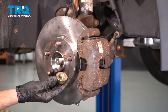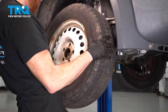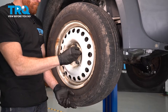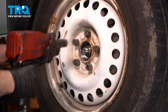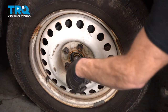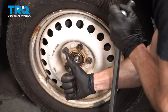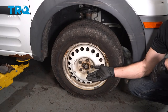After you've done that, you can continue on by putting on your axle nut. When you do this, you want to make sure that you tighten it up by hand as much as possible. Continue on by putting the wheel on. After you have the wheel on there, start on all five of your 19-millimeter lug nuts and bottom those out as well. We'll torque these to 100 foot-pounds in a criss-cross manner. At this point, take your vehicle for a road test. Make sure you don't hear any funny noises. Make sure there's no ABS light. And get yourself safely down to your local alignment shop.